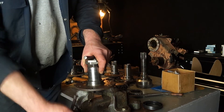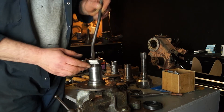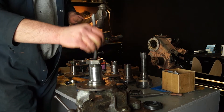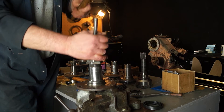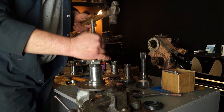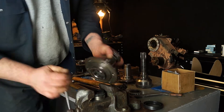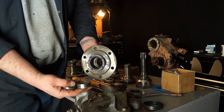What we're going to do first of all, with the vice, we're going to knock the bearing and the seal out. I have a cranked tool so I can get in behind there and whack it out. If you knock it from two or three different sides opposite to each other, eventually it will come out like so. It's not in there that tight and now we're ready to fit a seal and a bearing.